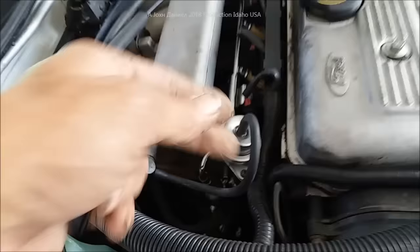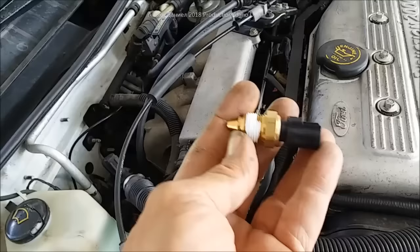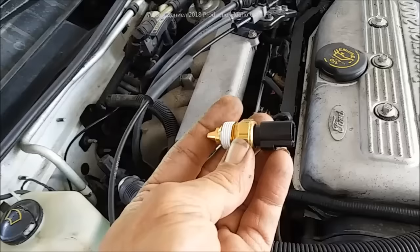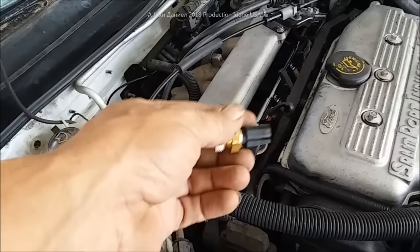In this one's case, this is an Escort with a two-liter, and even the Ford Ranger four-liter, the 5.4 Tritons, the 4.6 modular motors — mod motors — all of those have this because they all use a simply basic reprogrammed same OBD2 computer. Not much changes unless it's a limited version like a Lincoln Continental or something, because it has an engine system akin to the Jaguar. So this sensor is your problem.